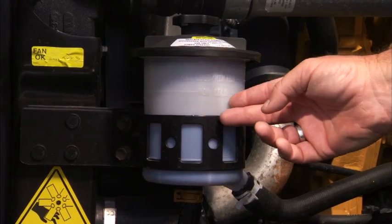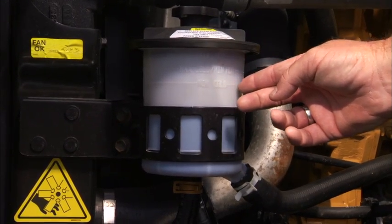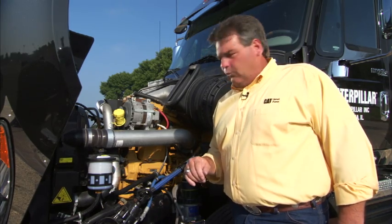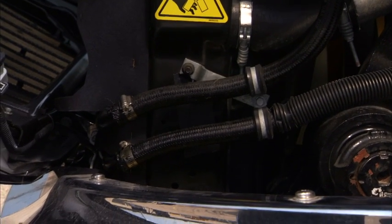This here is your power steering fluid, and you'll notice that on this model it's a little bit low. The fluid should be up to this cold line. If that's low, there's a pretty good chance there's a reason for it, and if you follow the line down, you'll notice right there happens to be the issue.